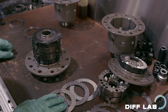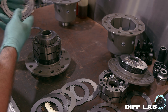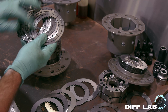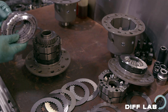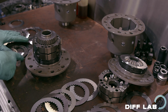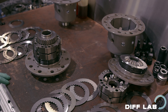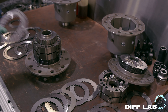So let's tear this down and see if we can spot any other differences. Taking all of these plates out — they all have this circumference groove, and they're all drilled. Separating them into inner and outer plates: same number of plates — 10 active plates, which means 20 plates in total. The number of active plates refers to the inner plates; you don't count the number of outer plates.